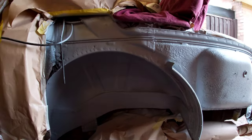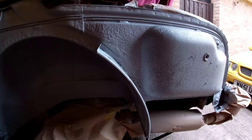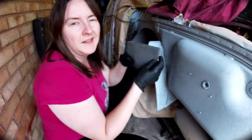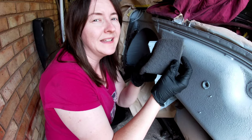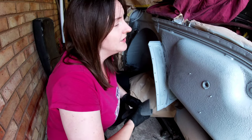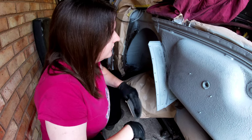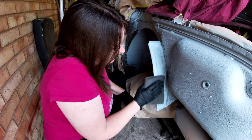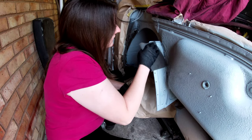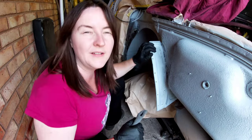Here is the inner wing. So you can see we've got etch primer concentrating on the bare metal areas. All seam-sealed up. Happy days! This is the stuff I use - Scotch-Brite. Because if you use sandpaper on this, you risk taking it back to bare metal on the edges and things. We're not looking for a nice finish under here, we're just looking for it to be protected. So on this occasion I'll just scuff it all over - give it a good rub, and it just takes the sort of gloss off the primer so then the stone chip will stick better.